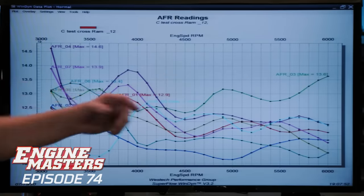But maybe that's got a really lean jet somewhere in a corner that doesn't really want it. See, because we just plopped those carburetors right on there with jets all over the place. Yeah, that one might have the number 63 in it, but how do you know which jet is reaching that cylinder? Because that's number three.